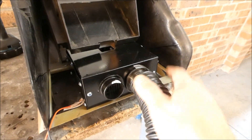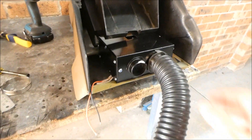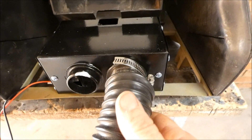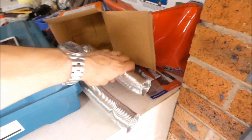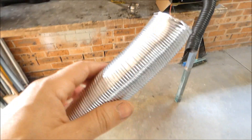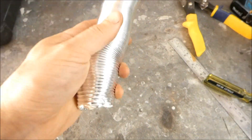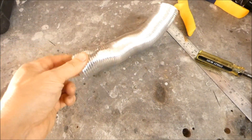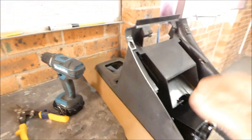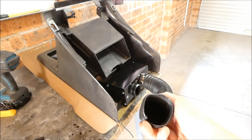It's got a dual outlet. I was testing because these outlets are 40mm and the hoses from the Cortina are 50mm. I just wanted to see if they closed up enough, and they do - with a 40mm clamp they're tight. The problem is these hoses that came with it are like an aluminium type that extend and squash down. You can extend them to the length you want and bend them to stay in shape, but I needed to extend them quite a way out to have a flexible enough spot to connect up to the air divider inside the car.